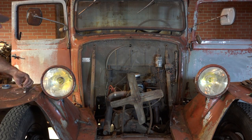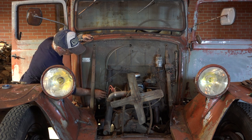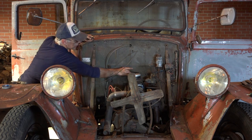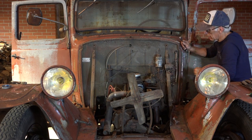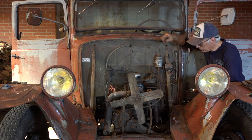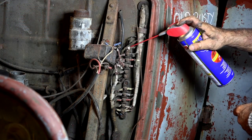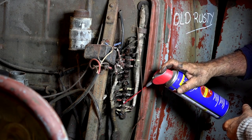There are a couple more things we'll have to do - we'll have to disconnect the speedometer cable. The throttle cable is already done. There's some more cabling to remove and then more linkage which is the gas pedal. The brake cylinder I probably need to remove that as well. So once we've got all this removed we will be able to lift off the cabin, after I've undone two more big bolts on the bottom.